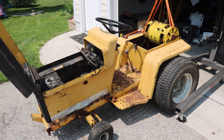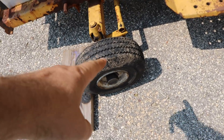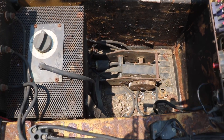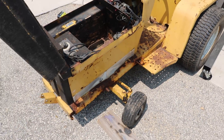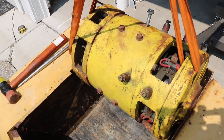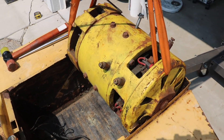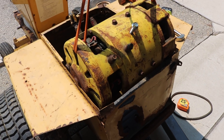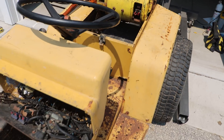I have here in front of me an old GE Electrac lawn tractor, but it's a really beat-up one. It's got the wrong little tiny wheels on front, it's all rusted, and not only does it not have batteries, but it's missing a lot of parts including the main drive motor. What I have back here is a 10-inch diameter series wound forklift motor — the one I originally had in my Geo Metro electric car conversion before rust destroyed that car.